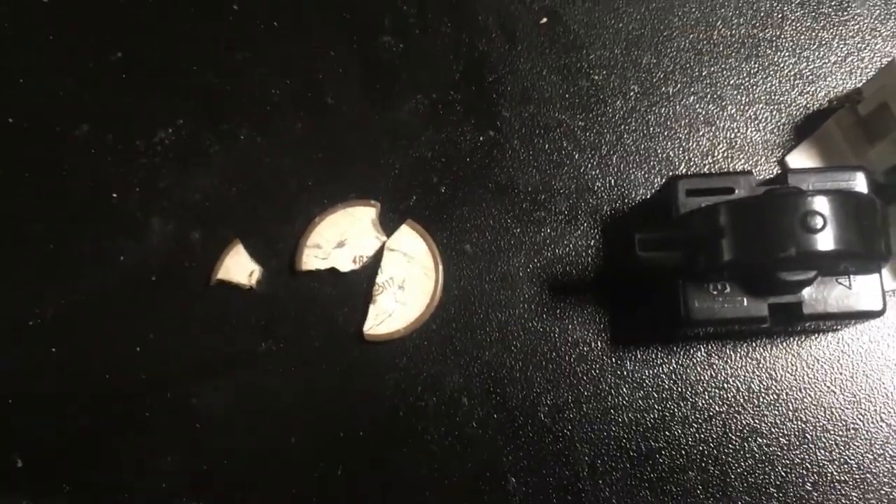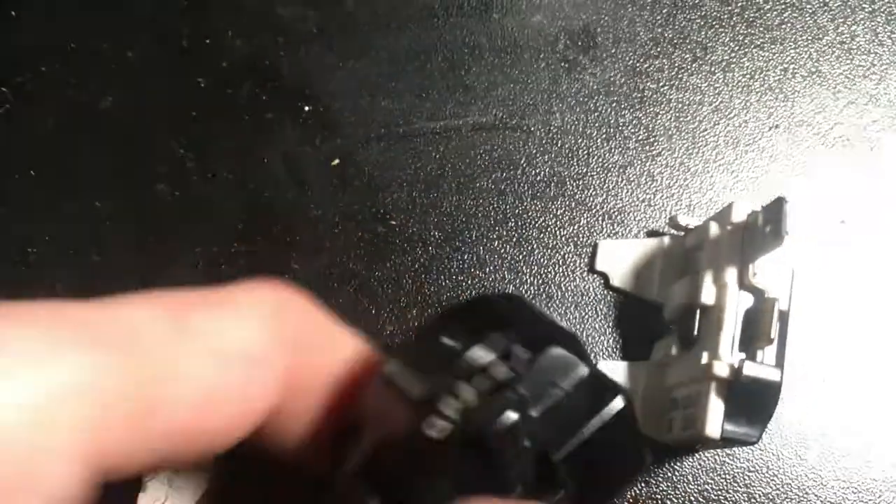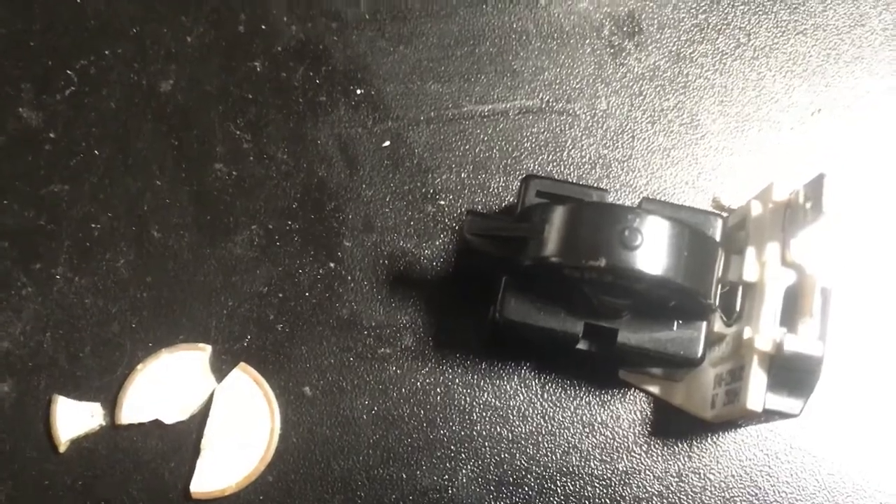It's like a little ceramic disc, and if that shatters you just get a new one. They're pretty cheap. For reverse installation, pop back on the flat relay and then pop on the run capacitor, plug everything back in — take pictures if you have to — then start up your refrigerator and see if it works. It's running!